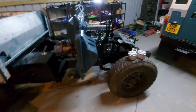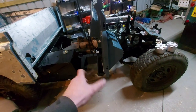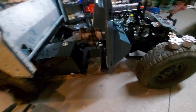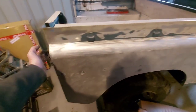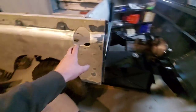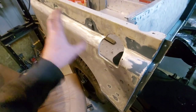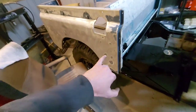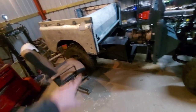I'll just give you a walk around, let's see where we're up to. As you can see, engine's in, gearbox is in, and the bulkhead is loosely sat in place with the bolts through the bottom. The tub's sat on there so I can get on and replace these rear panels. It's had a side panel on there at some point, and it's been riveted quite extensively. But I want to try and get it looking as original as I can, so these rivets are all going to come out. I'm going to bond the panel in place with just a couple of rivets where needed, not extensive amounts like that — that's a bit overkill.